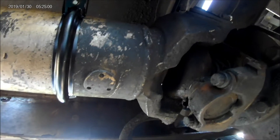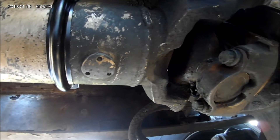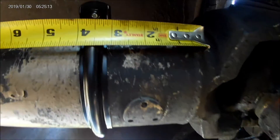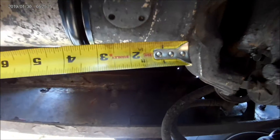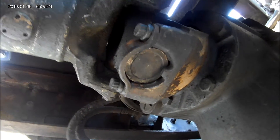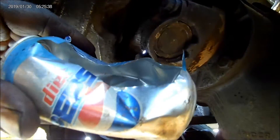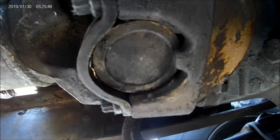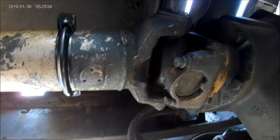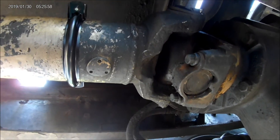Alright, so I got it back in there and put it back together. I put it like three and three-eighths inch from that weld. Reused my u-joint and u-joint straps. If you're worried about your caps turning, you can put it back together — just take a couple slices of a vintage Pepsi can, stick them in there, pinch them in, and it shouldn't turn after that. Going to do the one with the transmission next, but hopefully this works — I got a shake somewhere, I don't really know where, but I'm hoping this will get rid of it.